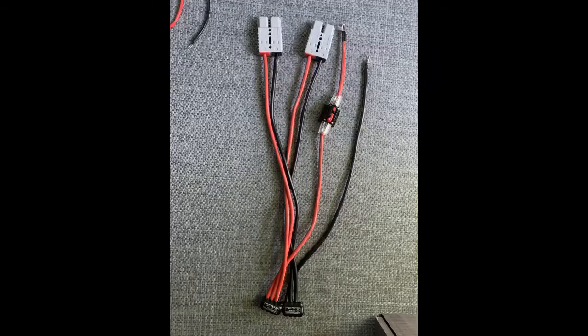That switch is in your converter — pull the face plate off and in the upper left-hand corner is that switch. The batteries, especially with the Battery Evos, the Anderson connectors, and the included four-gauge silicone-covered leads, it's a very easy installation. I used 40-amp breakers throughout.